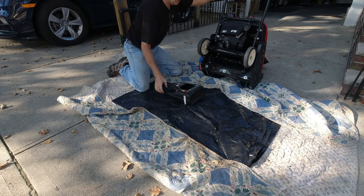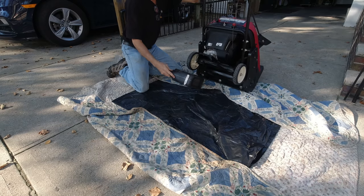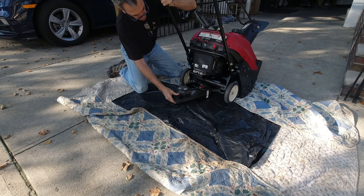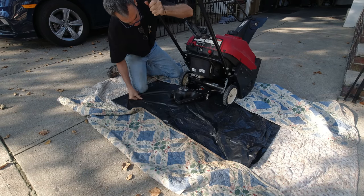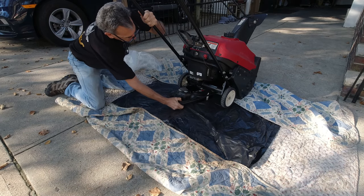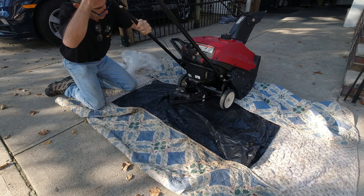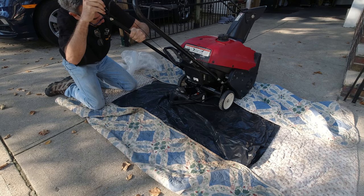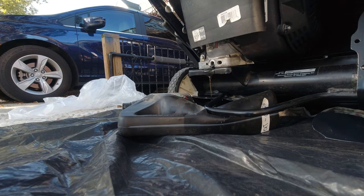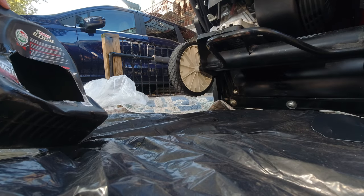Any tools in your way, please put to the side. As you tilt this out and under, the oil should start to come out — it's going to get on the snow thrower. So as I get myself situated and tilt my snow thrower down on the container, you can see the oil coming out. I tilt it further down and sit here and allow the oil to drain. I got most of my oil out.